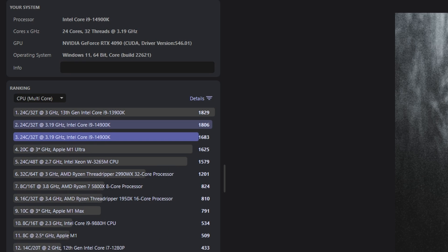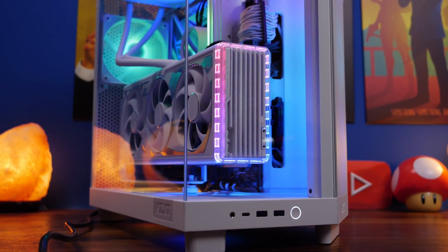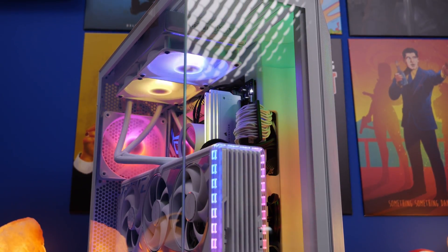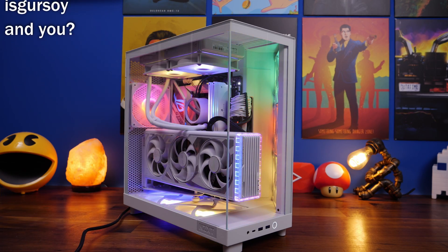These changes have made a difference — I've actually got a better Cinebench score, which suggests it's not thermal throttling quite as often and is running better. So it is worth considering the setup of your airflow, maybe your thermal paste, and checking the pump head. But especially it's probably worthwhile investing in a 360mm if you're going for a high-end CPU like this. Think about push-pull setup, maybe a larger radiator, and just general airflow in your case. Check out the links in the description for more about the case and everything else used in this video.